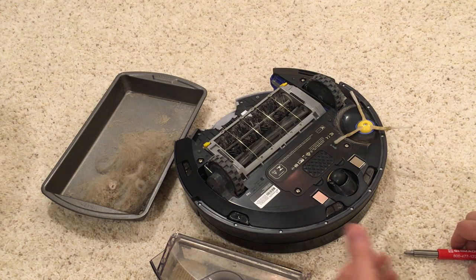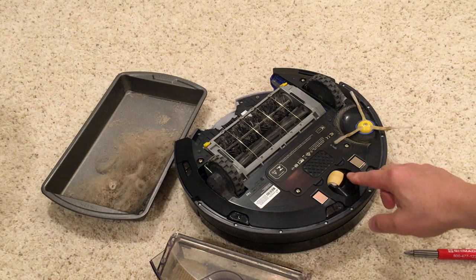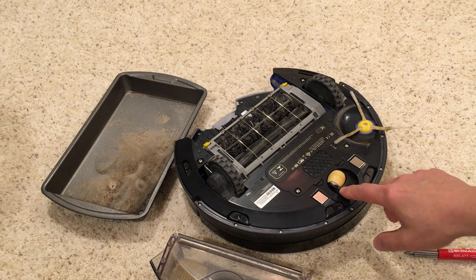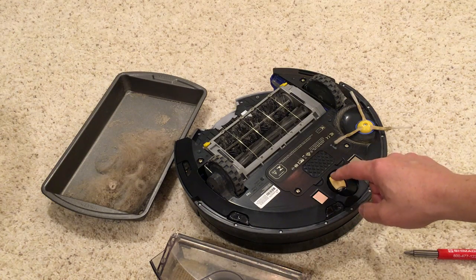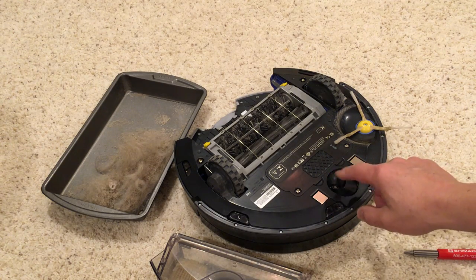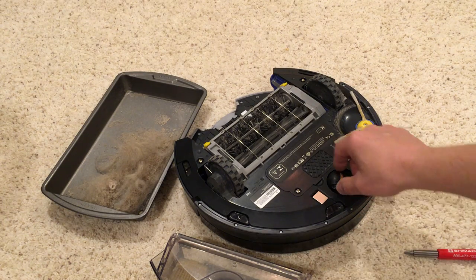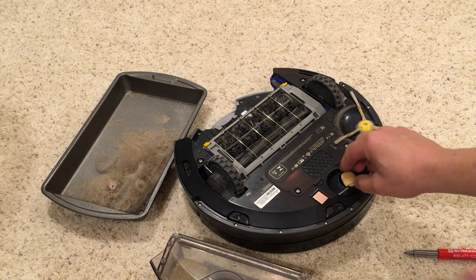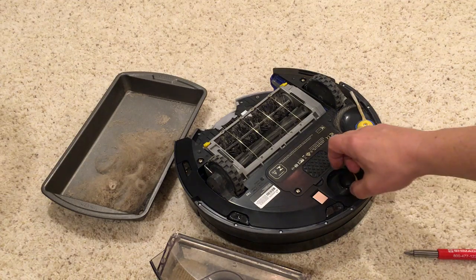The last piece that needs to be routinely cleaned is this little rotating wheel at the front — it's half white, half black. Hair gets collected in the shaft on this, and if too much hair collects, the machine has an optical sensor beneath this wheel. If it sees the wheel is no longer turning, it shuts the machine down and tells you to clean the hair out. If we just do this every day, we typically avoid that shutdown.